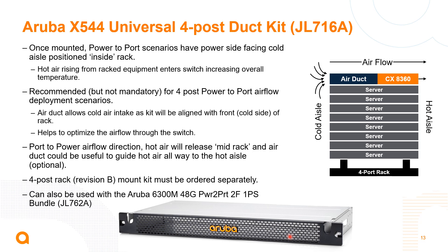These switches are targeted for the data center with both back-to-front and front-to-back airflow options. For back-to-front configurations, we're introducing an air duct kit that can be added to all five switches within a four-post rack. This ensures that switches — which are usually at the top of a rack with servers emitting heat below them — are pulling in proper cool air from the back for optimal airflow. As an FYI, this air duct kit can also be used with the 6300, our out-of-band management switch targeted for data centers.